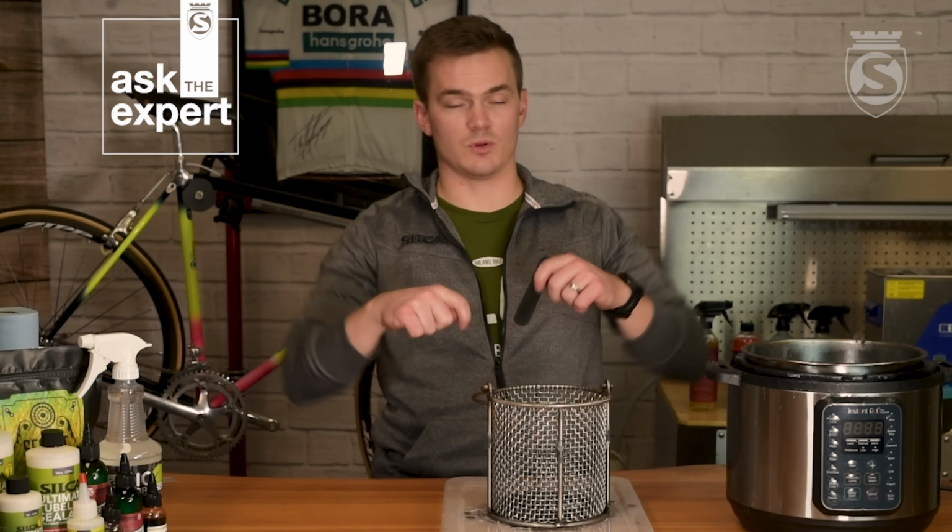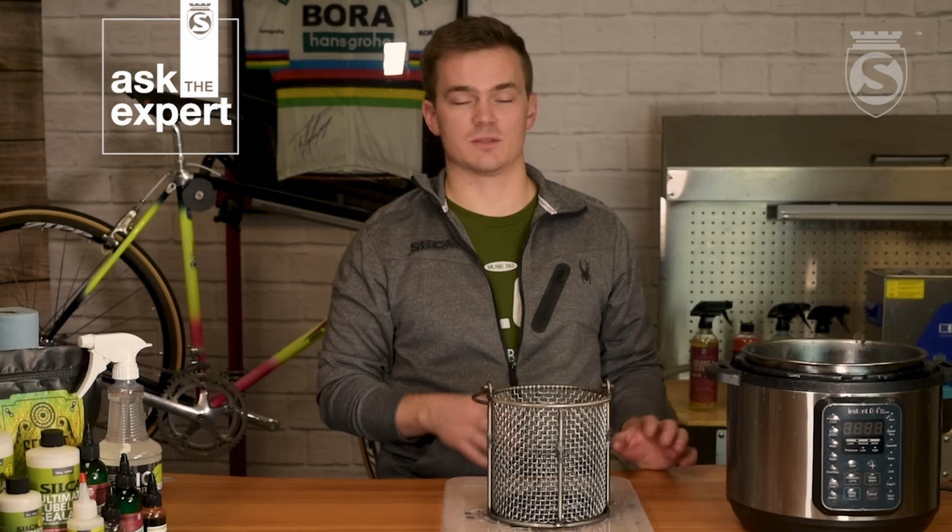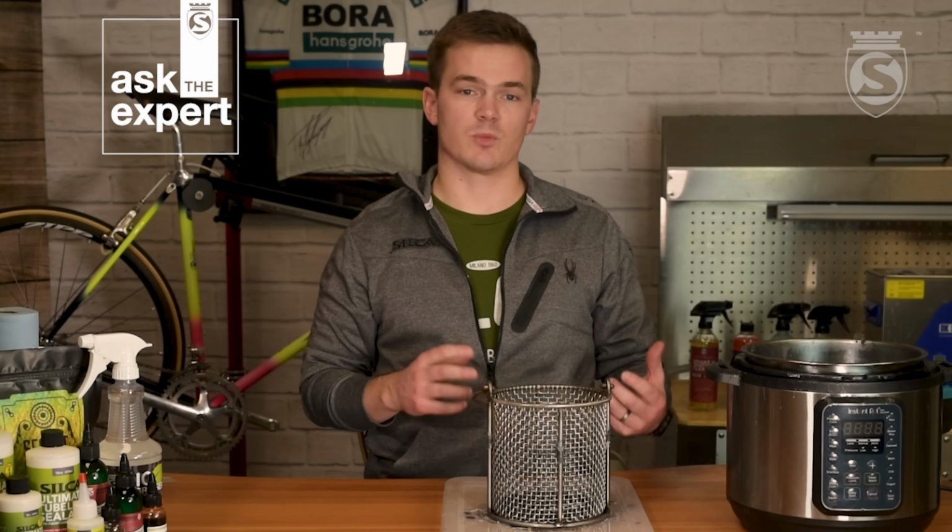As soon as it's cool, it'll be hard to the touch. You'll have trouble moving the links. Don't worry, that's how it's supposed to be. You just melted wax all over the chain. So you can do a couple different things to break the chain in.